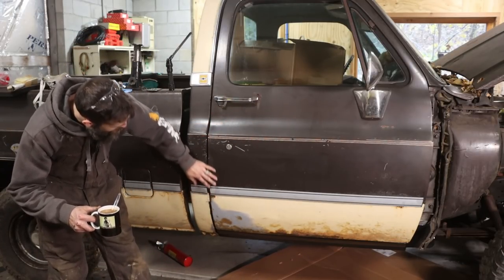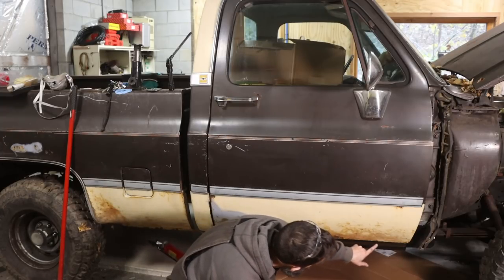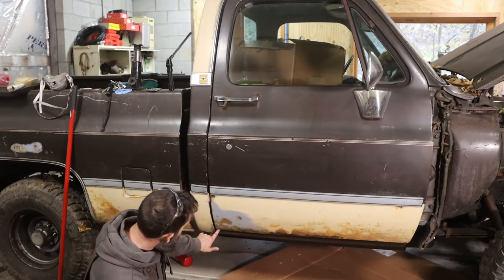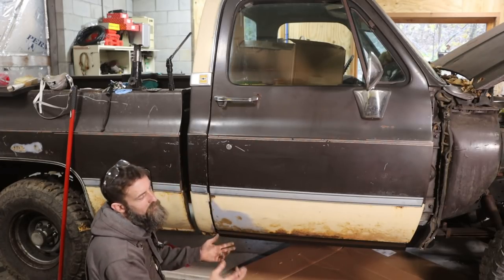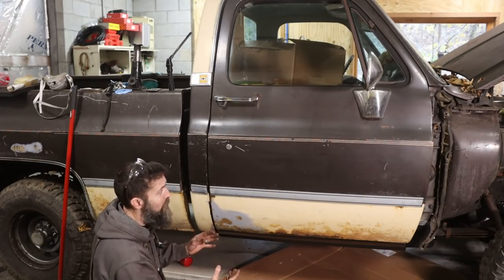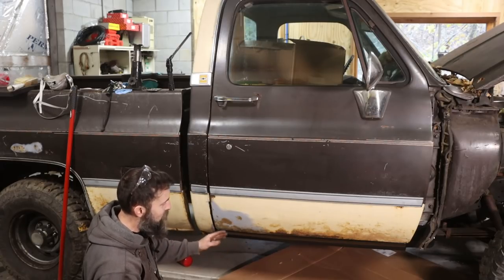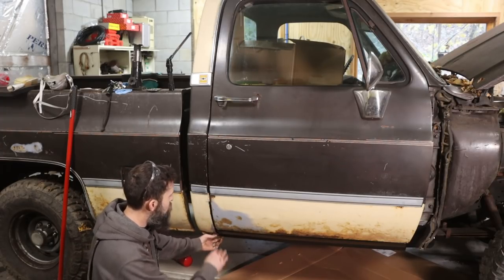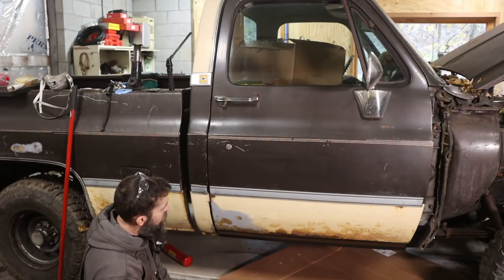You can't go by these pinstripes — it's only got the top line on the cab and it's missing the top line on the rest. The crease in the cab looks good, the molding looks good, the gap looks pretty good. But most important is the rocker gap — it's tight on one end, pretty good gap there, then a little loose down here. So I'm thinking I'm probably going to have to cut this back loose at the weld. The straight lines on these trucks draw your eye and if that's crooked there's nothing you can do once it's welded in. That's why we fit the door first.